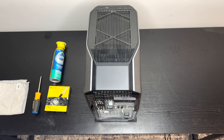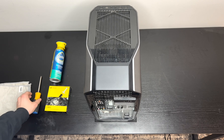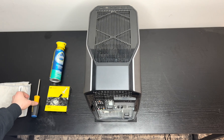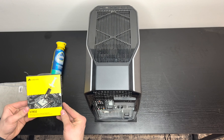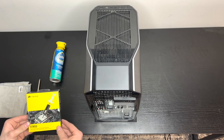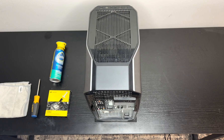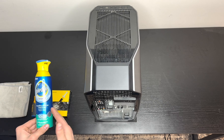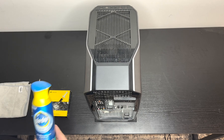Some things you're going to need today — I'm going to show you how to take it apart and what you'll need to clean it. You're going to want paper towels, q-tips, or rags. You'll need a Phillips head screwdriver. If you plan on replacing your thermal paste on your CPU, get thermal paste — I have the Corsair thermal paste, common at Best Buy and Walmart. You also want to get a can of air for cleaning dust on the outside, fans, and stuff.